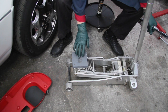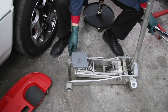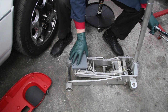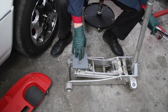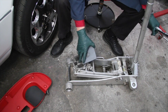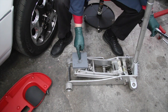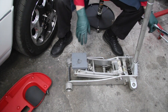It's highly recommended that you get a good hydraulic floor jack similar to this one and a set of jack stands, as you see here. Take your floor jack and modify it with a couple of blocks of plywood. This has to be good quality multi-ply plywood, not the cheap stuff. Cut some six-inch or four-inch squares so these pieces of plywood can sit right here. This is going to protect the underside of the car and help keep it from slipping. I love to use wood between the jack head and the car body — that's something I learned a long time ago. When you jack up on a part of the car, it's going to kind of embed itself in the plywood, and the same thing happens with the teeth on the head.